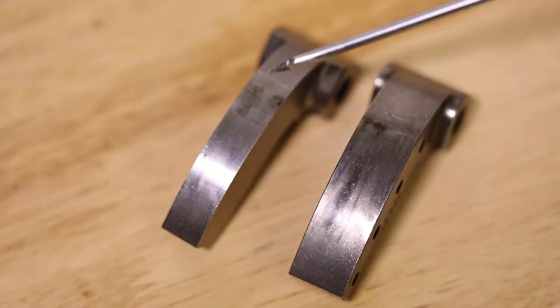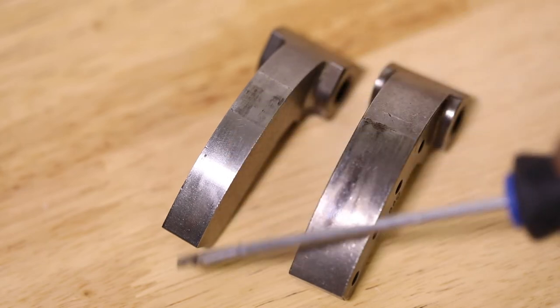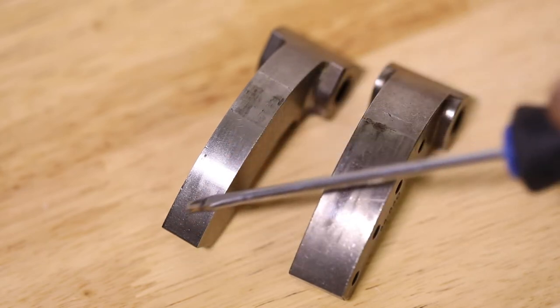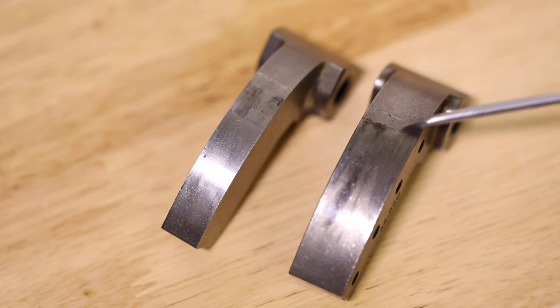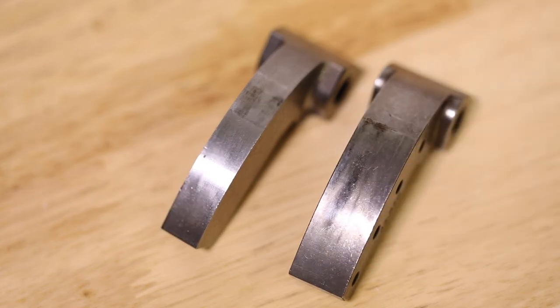As you can see on the stock weights, they are rather skinny but there are no grooves — nice and smooth through this arch. This is the same with all the new weights from SSI or BDX. There are no grooves in these weights to hold up the rollers in the primary clutch.